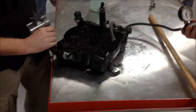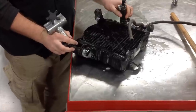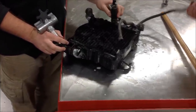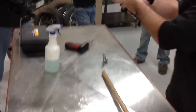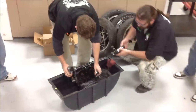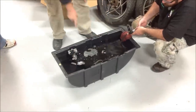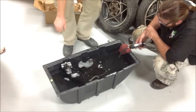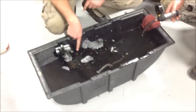Now we're going to show you the ultimate test — go ahead and pump that up a little more. What do you have right now for PSI? About 17. Crank it up. All right, now we're going to walk over here. What we've got is a tire testing tank, and this is great because now we've just submerged the whole thing. Let it sit a little bit. Do you see how we're getting bubbles in there? If my other areas that I'm worried about are cracked or broke, it's going to be that obvious.